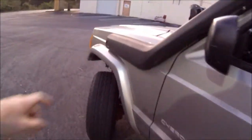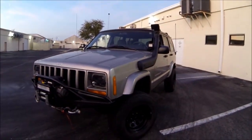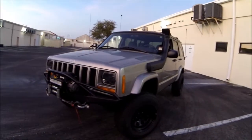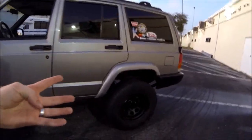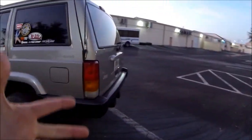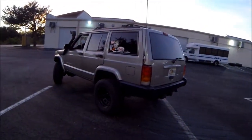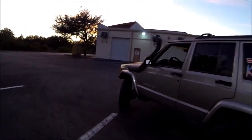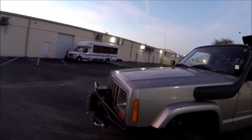I ordered a bunch of switches for the center console switch panel — six red switches. Right now they're wired with the little 12-inch light bar on the bumper; I want to separate those. I'm going to get a light bar for the roof, so that'll be three switches: light bar, pods, and the big one on the roof. The other three switches: rock lights brings it to four, rear lights brings it to five, and I have one extra. I'm thinking about doing a fan override and putting that switch on there in a different color when it lights up. So that'll be my six switches.